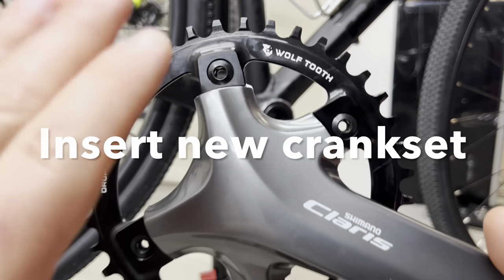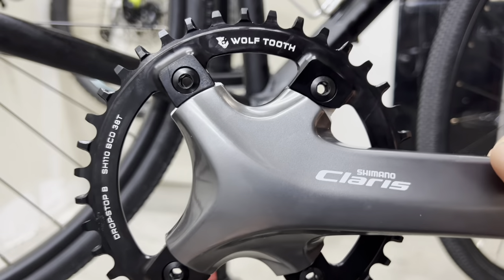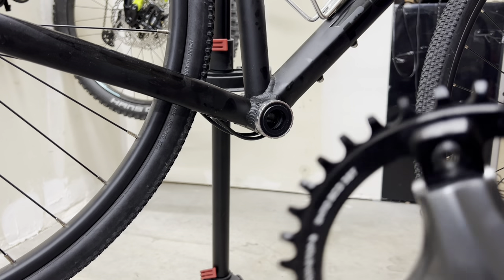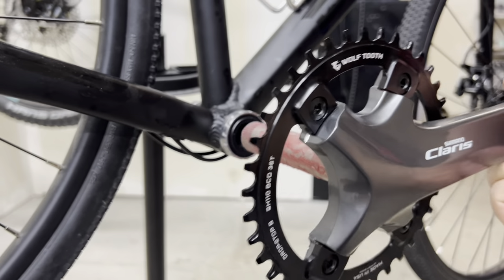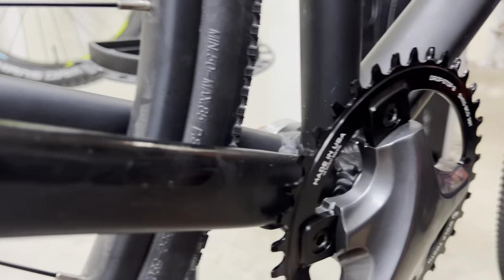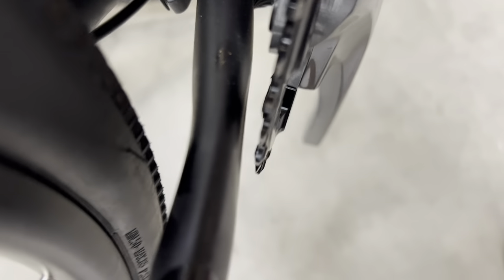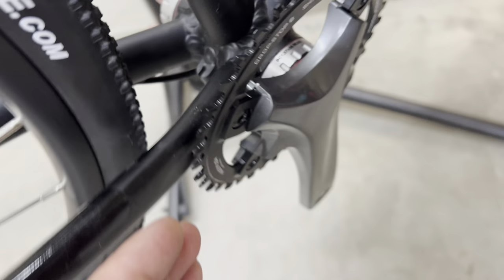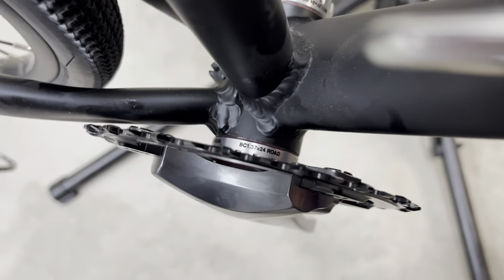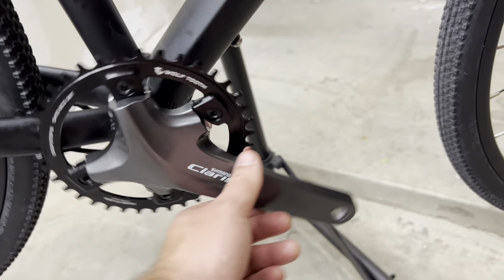It's time to see if this new crank set actually fits with the new chain ring. This chain ring is designed to improve the center line of the chain, pushing it in just a little bit. Since this is actually made for a road bike and not necessarily a gravel bike — the frame and chain stays are just a little bit different — hopefully this actually fits. I think we have enough clearance; I think that is going to be just perfect. With that 38-tooth chain ring, it does in fact still clear the chain stay — looking really nice down in there. This thing is going to be awesome, a very big upgrade over the last bottom bracket and crank set.